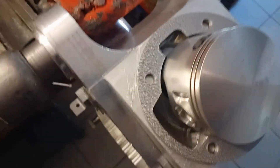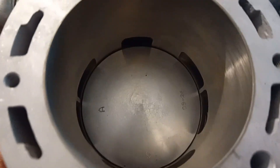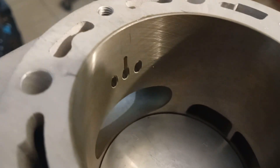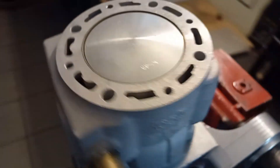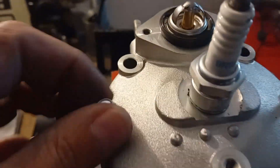Now let's put the barrel on and see how the situation looks. Perfect, I would say. The ports are completely free, even a little bit lower. The barrel is designed for 62mm stroke but we have 64mm, so we have a different kind of timing. We have three decompression ports — the TOR 250 has just two — but I will leave them. And at the upper dead point, it's again an ideal situation, so we can easily put the water-cooled head on it.